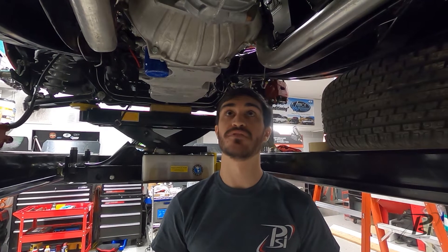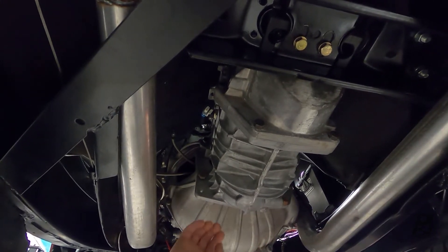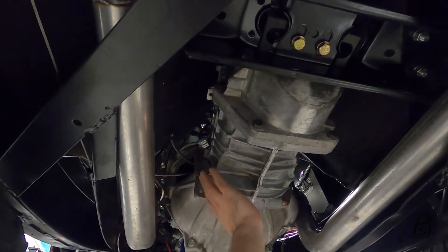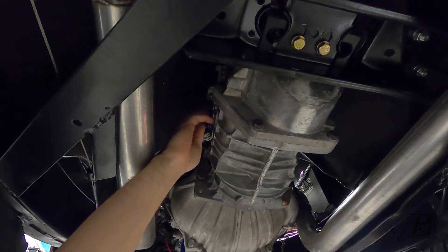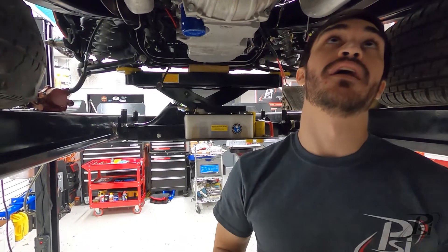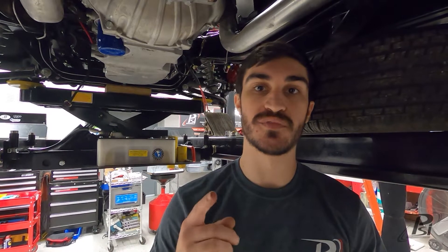The only other wiring underneath the car for manual transmission setups is your transmission wiring. On this T56 harness you would normally have a reverse lockout, but since this is a TKO 600 transmission I did a little custom work — I'm going to use this to hook into the reverse switch so I can hook it up to our American Auto Wire and run fewer wires in and out of the cabin. The only other thing to plug in on this transmission is the VSS — it's a two-pin plug.